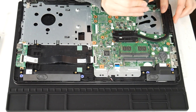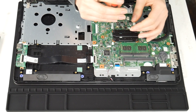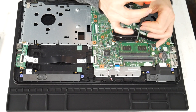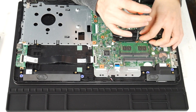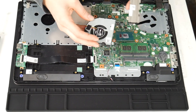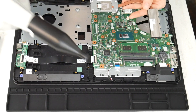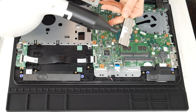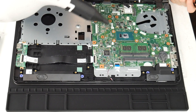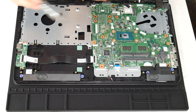Next, I'm going to clean the heat sink. This is another big reason why a computer overheats — the fan and the heat sink are not working properly together. Now that I've gotten the heat sink off, I'm going to clean out that little vent there, because the fan takes the air and expels it through there and all that hot air goes out. If those two things aren't functioning properly, your CPU and motherboard can't stay cool. I'm going to give it a good blast with the air cannon. I do recommend these air cannons because you can clean out the inside of your computer really easily. Sometimes you open it up and they are filthy because you use your computer for everything.